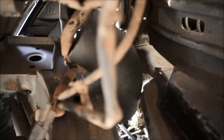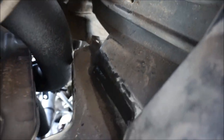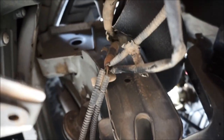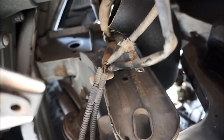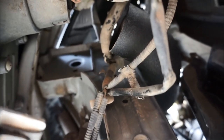And then you're going to wiggle it all the way down underneath here, and it's going to come out right there. You guys see that? There's a little push hole right there, and you just wiggle it through, and it'll sit up where that fog light is, and it'll get some nice, cold, fresh air down here. You don't have to have the filter on. You can put the filter on afterwards, and I'll show you guys how to slide it on.